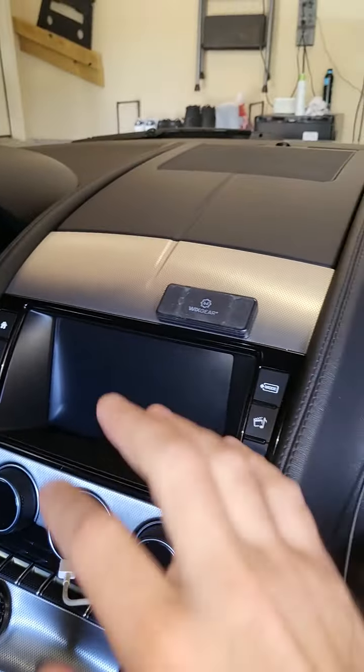And it goes all the way under here, pushed it up, brought it around the back to take up the slack so I didn't have any loose cables. Brought it into here and boom, right into this 3.0 plug. That comes on when the car comes on. Starts recording as you're walking up to the car, and of course when the car turns on it has power and it keeps going. So that's good because now it records what's going on in front of my car and behind my car while I'm approaching it, which is an added little benefit.